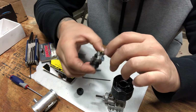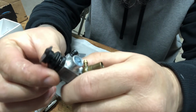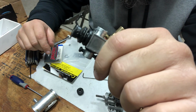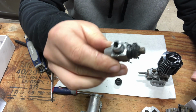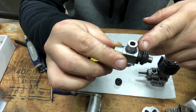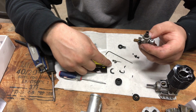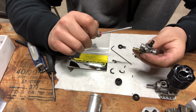So we are gonna go ahead and I got some O-rings. I got a new boot for the shaft on the carb, and got a couple O-rings here. I'm gonna go ahead and put these in and then put it on. Here's the old boot. I mean, it's just as brittle as it can ever be, and it's cracked in there, and you get air, which causes tuning issues. So, as you can see, it's in pieces. That's how bad it was. I had to use a little pick to pry everything off. It was just glued.